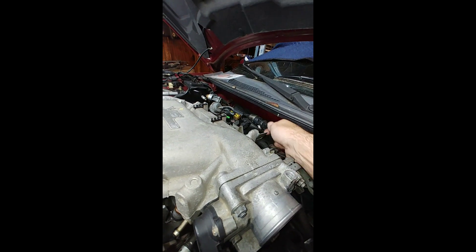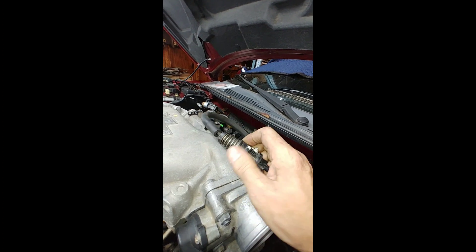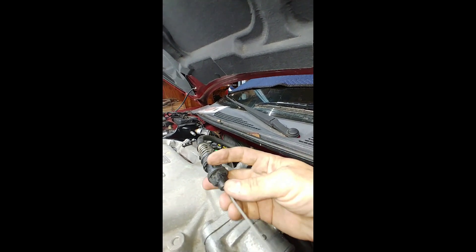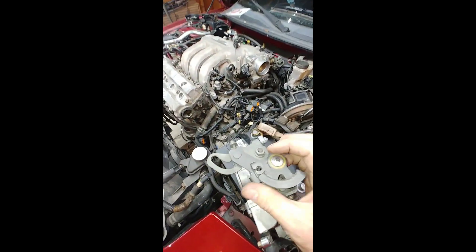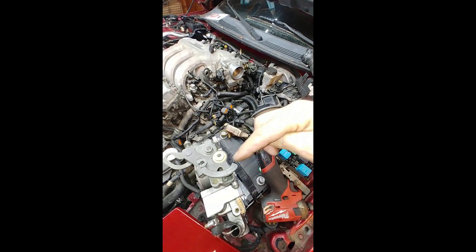The fourth adjustment is down here. Normally this is never messed with, but this is your throttle cable, and this piece right here is a lock. If you pull it, you can actually rotate this — see the little white paint? That is where it's set from the factory. But if you rotate this, then this whole thing goes in and out. And that piece, which snaps into this piece right here — you're adjusting where the base cable length is going to be.